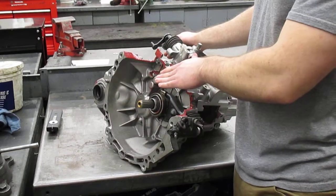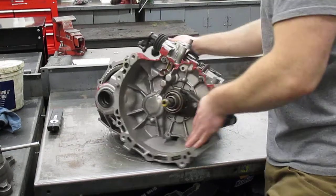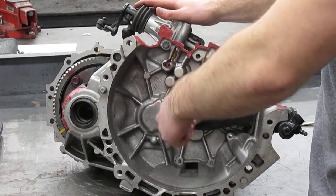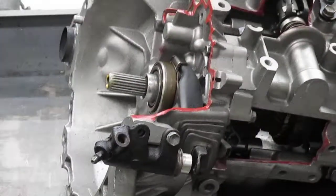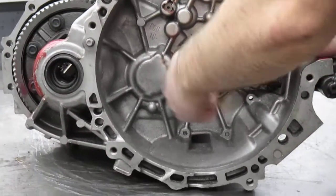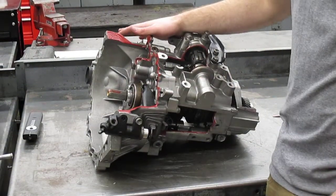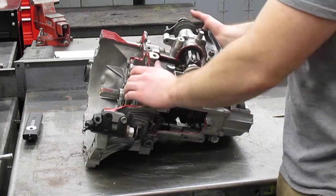I'm not going to count the rest of the gears because that would take a lot of time. But as you can see, when I shift into second, it's going to be more speed and less torque, so the gear reduction is going to be a little less. You can actually see the differential gear moving faster on the left. Same story in third — this is going to turn more per one turn of the input shaft compared to first gear. As you get higher, first gear will be fourteen to one — the highest gear reduction — and sixth gear ends up being around three point two five to one. I'll show that right now.